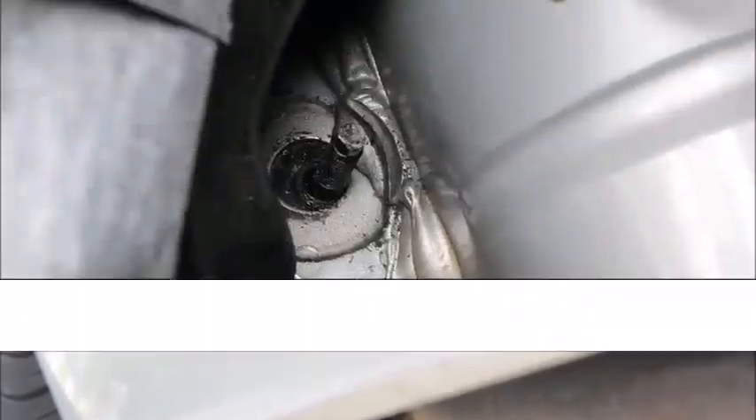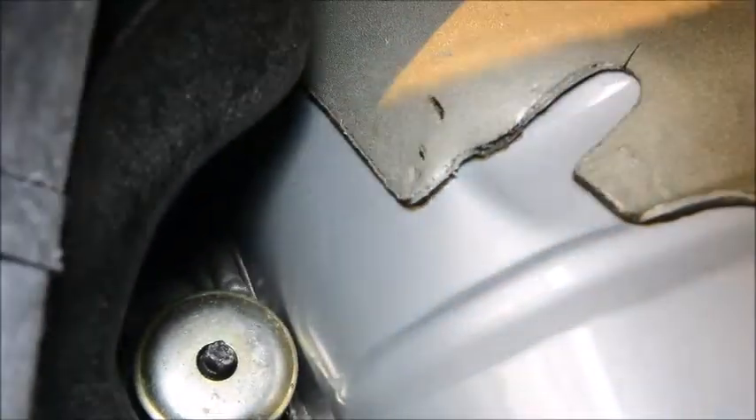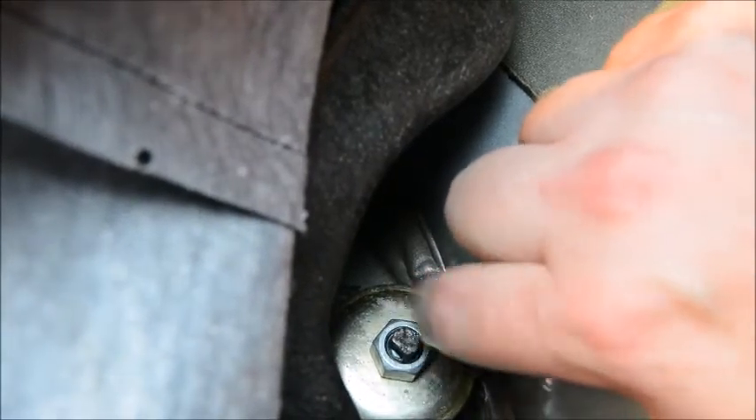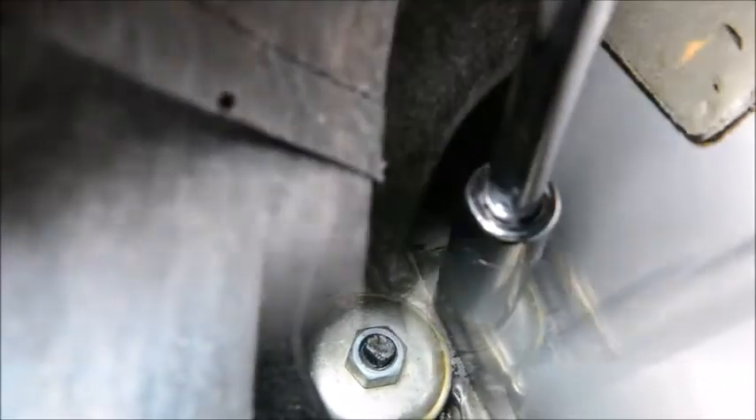That's pretty well good. Now with the shock through the body, we'll put on the upper rubber insulator and then the upper washer, and then put the nut on. It's a little close to the side of the body, so we want to slide it over just a little bit, then torque it down. It might be a bit tricky — if you don't have a power tool to zip it on, you might need a wrench to hold onto the flats, but it's quite awkward. You don't want it ridiculously tight, just reasonably tight. Here goes with the power ratchet — that seems pretty good, got a little bulge on the insulator, and that feels just right.